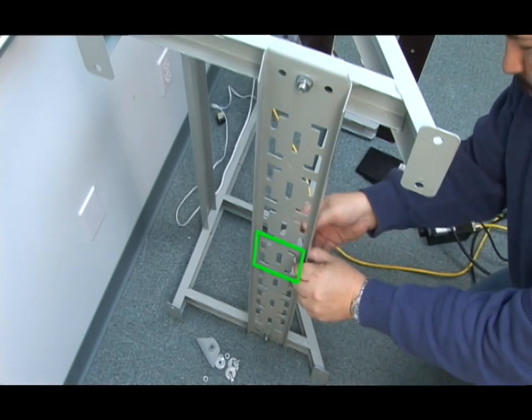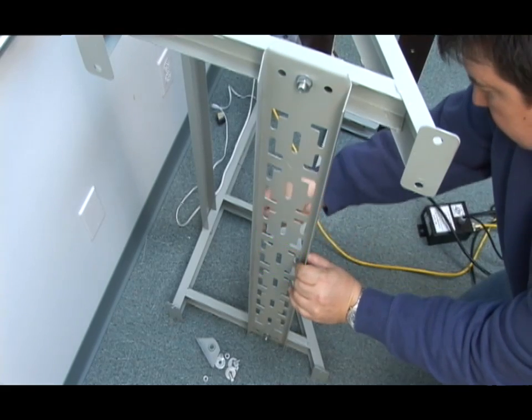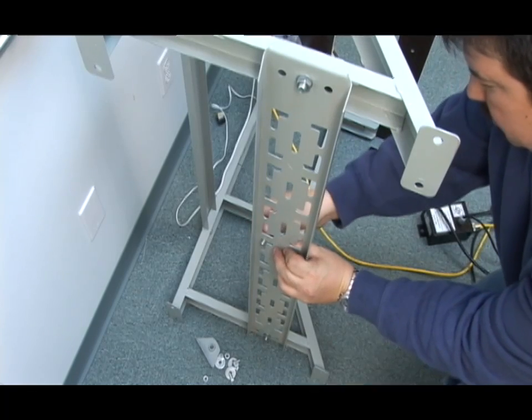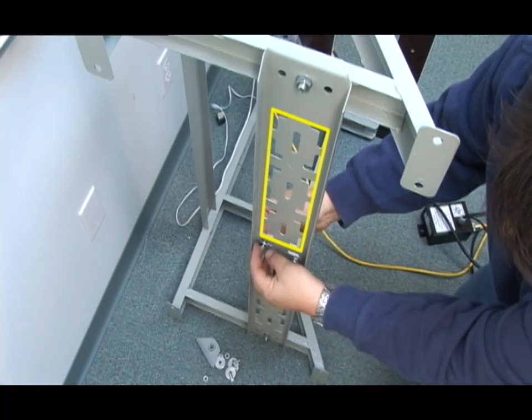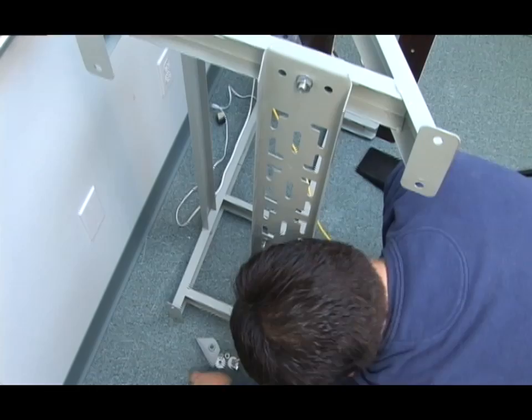This position will install the left bracket that holds that foot treadle in place, and we'll use a nut, a washer, and a bolt. The washer and the nut will go on the underside. The position here will leave for any kind of a foot treadle for, say, a clutch motor if you have that. So this is a good position that we're installing this in to put that.